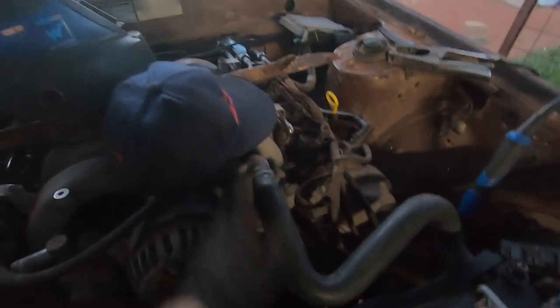This top hose here is a bit kinked, so we'll just chop a little bit off of there, and that will straighten things out in that department. Down here, hopefully there's still enough light to see. No, there isn't. Oh, there we go. So you can see the fan here was hitting on that sensor, but now we've got plenty of room down there. I'm not sure if you can see all the way down in there, but that bottom radiator hose now will have enough room to go on and be able to be tightened up.